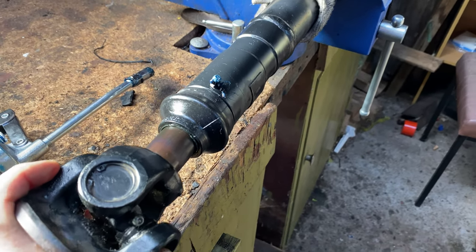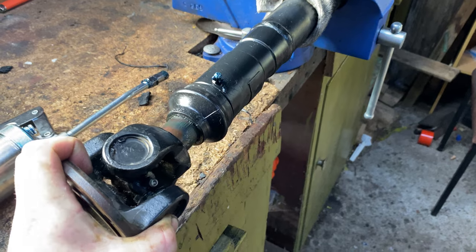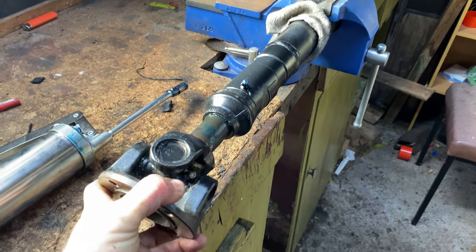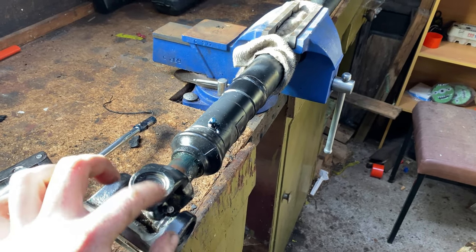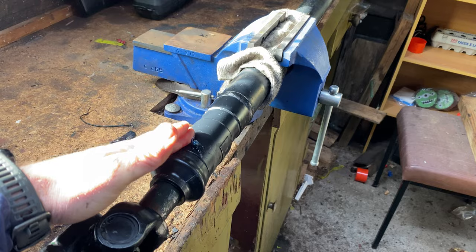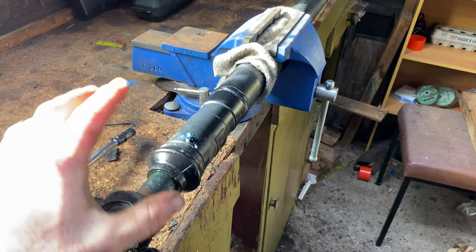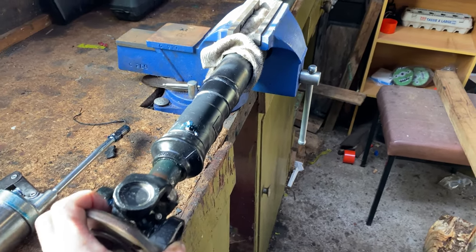With the spline, we really want the in-and-out action to be operating quite fluidly, because when you're going over bumps and articulating the rear of the vehicle, this is doing that the whole time — going in and out. If it's not doing that, it puts stress on the universal joints, the yokes, and other parts of the vehicle. It also wears out the spline on the prop shaft because it's got to move fluidly.